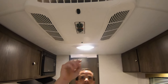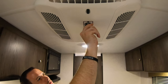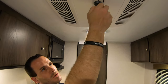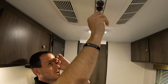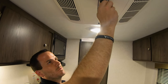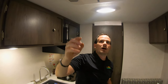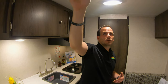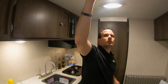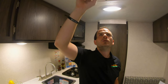The air conditioner is a manual control with a few different settings: off, low fan, high fan, low cool, and high cool. Most of the time I like to run on high when using the air conditioner so it cycles quickly enough — that pretty much stops the risk of them freezing up when it's really hot. If it's not that hot out, maybe at night, you can run it on low cool. High fan and low fan are for just cycling air through, and you also have a temperature control.